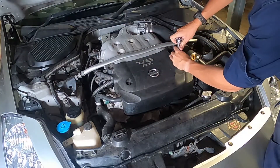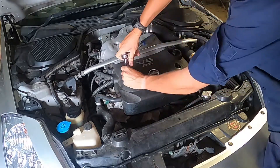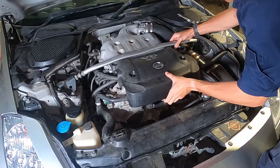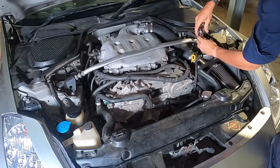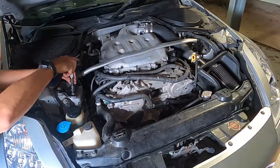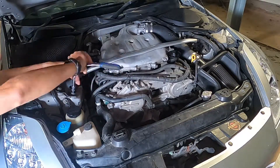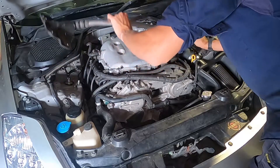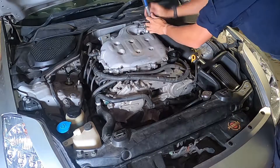We're going to start by taking off the engine cover. All it does is hide some wires and tidy up the engine bay. I'm actually going to leave it off at the end of this video — it'll save me a bit of time. Now we're going to take off that strut brace there. I don't think these are on the V35s and G35s, so they won't need to worry about this step. I'm just going to pull that out and that'll let us take the top off the plenum.